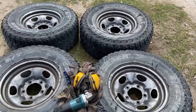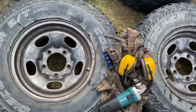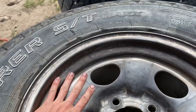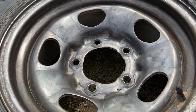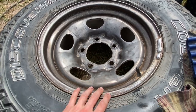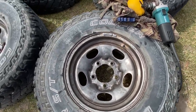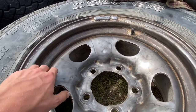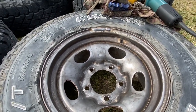Now that we've spent quite a long time sanding the paint back off these rims and getting the rust off, this is kind of what you're aiming for. Firstly and most importantly you want to get rid of all that rust — you want to have a really smooth touch and get into all of these crevices. Honestly there is no substitute for really putting in some time and elbow grease here, because the more rust and paint you get off the better the paint will look at the end.